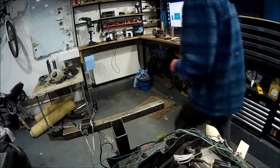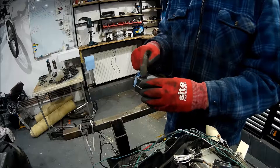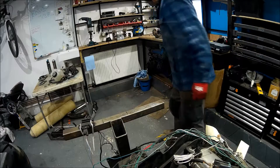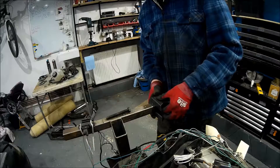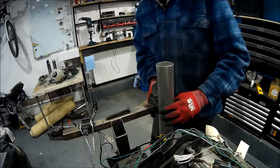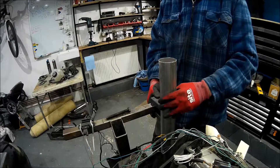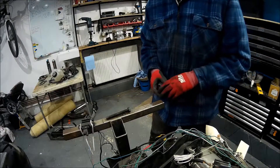Halfway through, I've done these two little brackets. These need drilling out to 13mm. I'm going to drill two new holes in here — I want to bolt one below with some big bolts going all the way through, bolted on there so it's removable. And I'm going to weld that onto there. Hopefully that will be super strong, because it's going to take all the weight of the turbo — which is around 7 to 10 kilos. So I've got to weld that on there tonight.